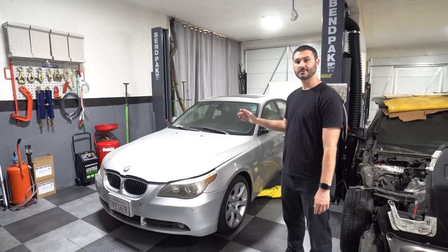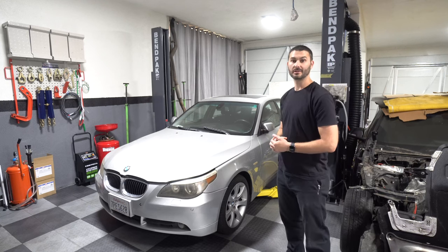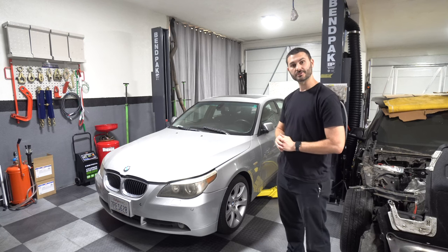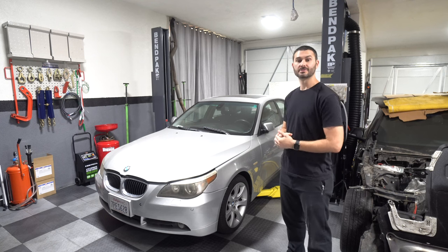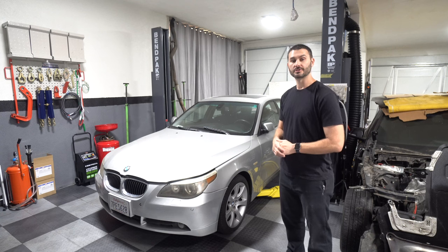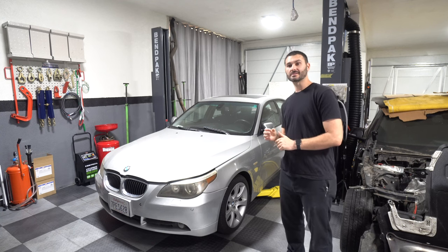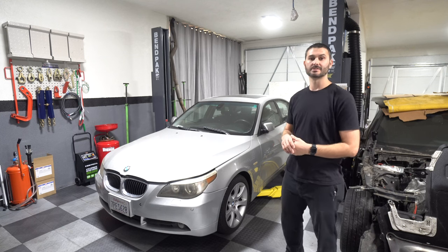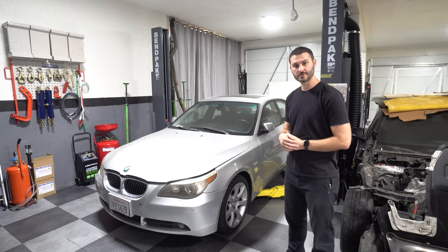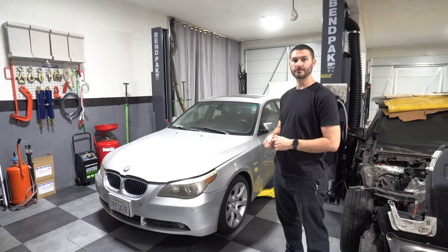All right, guys, that's gonna do it for this video. We've got most of the electrical components put back in the car. It is running and driving. I took it out for a test drive and everything seems to be pretty solid. Except for a small issue with the transmission. It's got a hard downshift and a slight maybe slip or shudder. I'm hoping if I do a transmission service, it'll clear that up. So we'll be doing that in the near future.